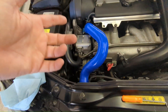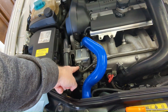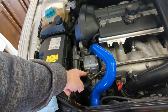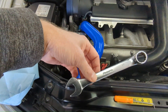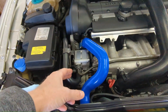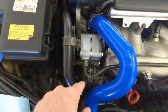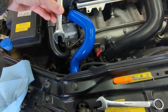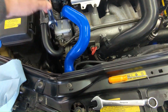This coupling is a 16 millimeter, and my Pittsburgh wrench set from Harbor Freight doesn't even have a 16 millimeter. So there were two options: 17 millimeter can work, you just have to be really careful — it will go on and turn it, though it doesn't get really super tight until you're inside that three millimeters. The other option is a five-eighths, which will go on there if you wiggle it in just right.